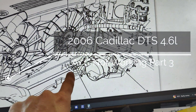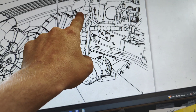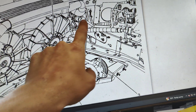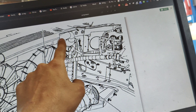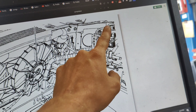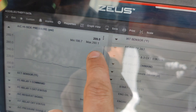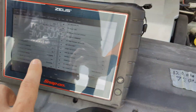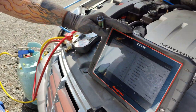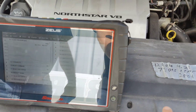Here's our high side pressure sensor. It goes through here, then through our condenser, and comes out to our high side port right here. We have high pressure going into the condenser, then it's dropping and becoming low to our sensor. Pressure is at 211 psi — our gauge says 209. Now if I shut this car off, watch what happens: it drops to 180, but this starts coming back up. That's because we've got a restriction between our condenser and that fitting.